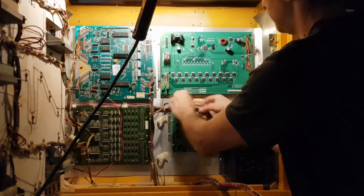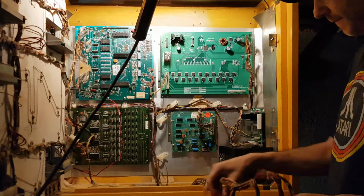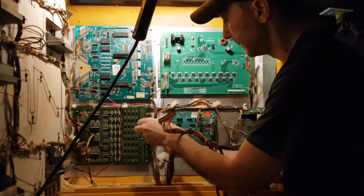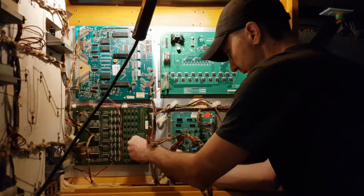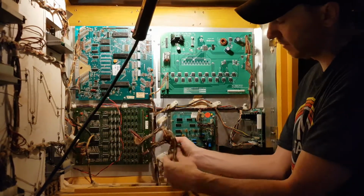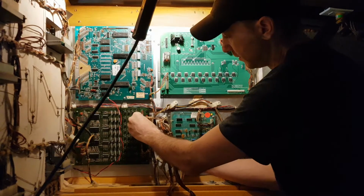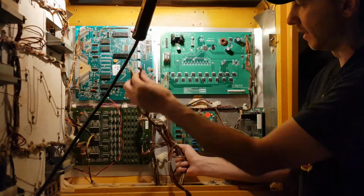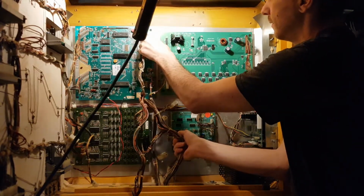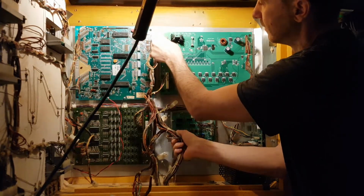And then feed our wires into the wire clamps there. One more connector to go. This says J3, so that goes there. This says J1, and the connectors are positioned roughly where the boards are. The next one up, obviously, goes higher. This says J2. This one can't really go anywhere other than right here, so voila.